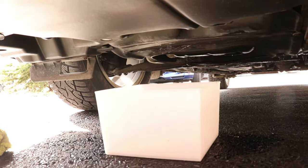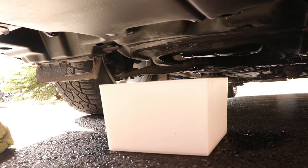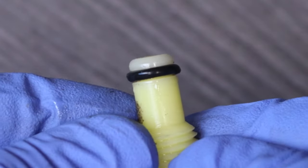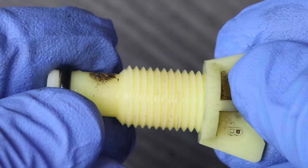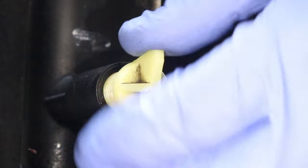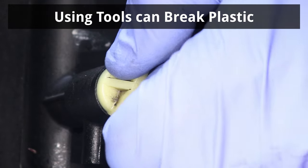The plastic cover can carry coolant to other spots as well, so make sure to have another drain pan ready just in case. Once the coolant has finished draining, the drain plug can be removed and inspected — making sure the o-ring is in good shape with no flat spots, cracks, or visible damage, and the plug should look nice and even without any cracks. When reinstalling the plug, make sure dirt didn't fall in the radiator tube, and the plug and o-ring should be kept completely clean. I'll tighten it by hand only, as using tools can over-tighten it and break the plastic.